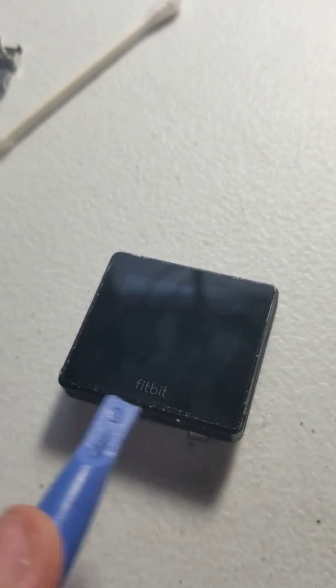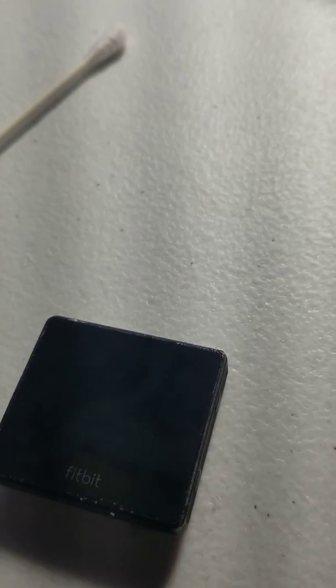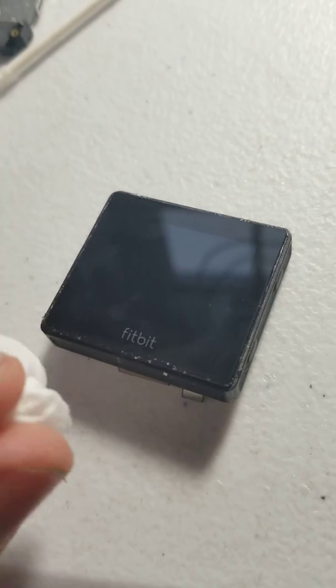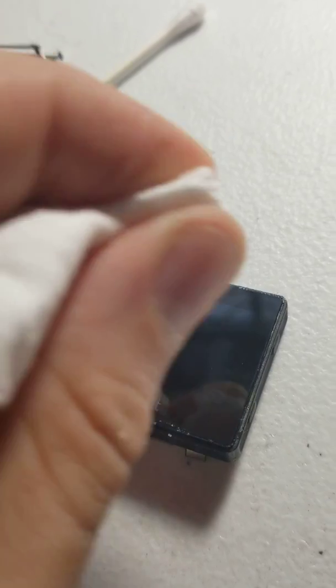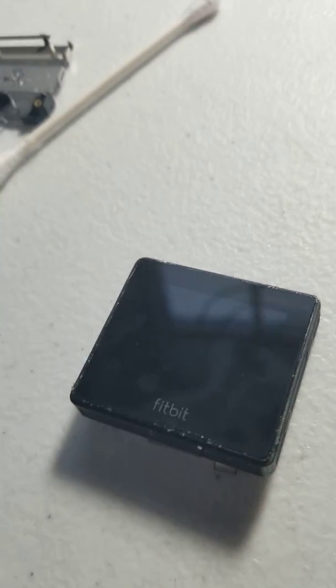As you're working in the new screen and getting it to sit properly and letting that adhesive set, if you're pushing it in and any adhesive comes out, you can use the tip of a spudger and kind of run it along and get that gel out of there. The Q-tip doesn't work well because it's got little fibers and it will stick in the glue. So you can use maybe a little piece of toilet paper, especially if you can wet it with a little bit of rubbing alcohol, and try and just go right around the edge and take off any of the excess adhesive and it'll clean it up.